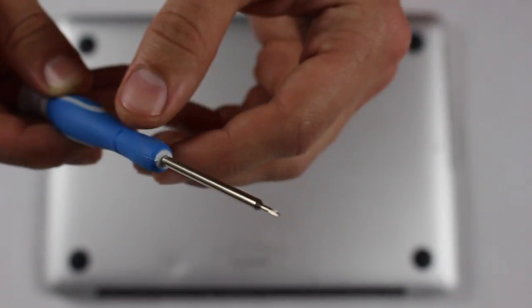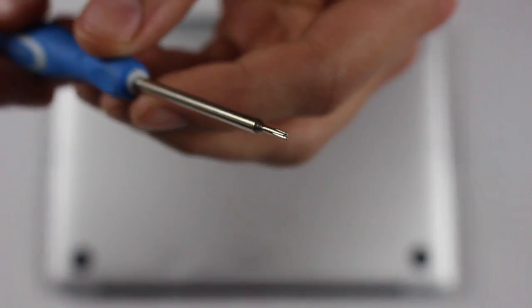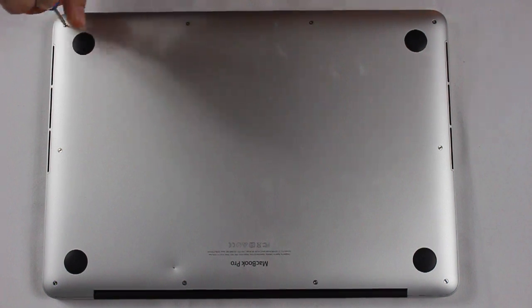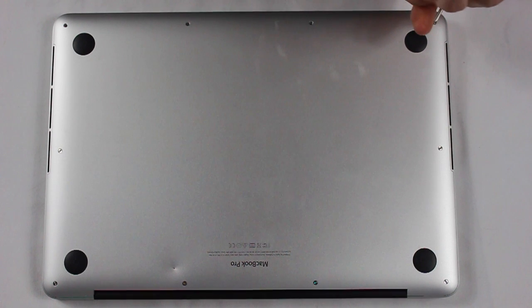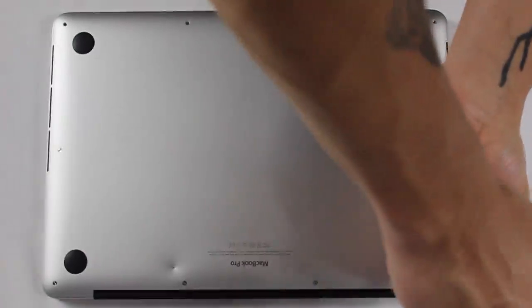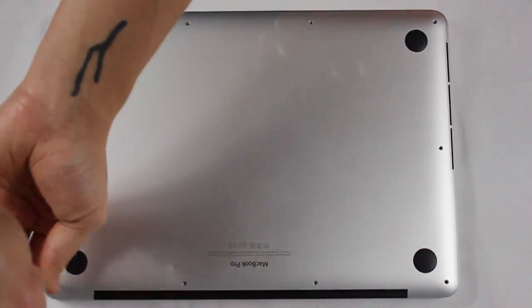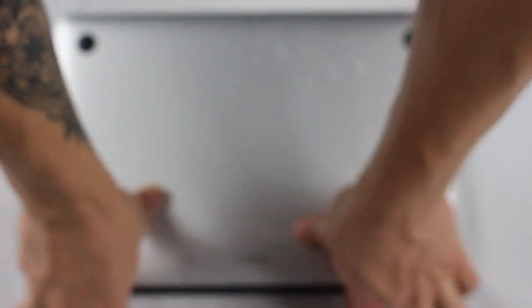It's very small and very thin as you guys will see here in a little bit. One of the tools we're going to need is a 5-point pentalobe screwdriver — these are very inexpensive, I got this for around $3 or $4 on Amazon and I'll leave the link in the description. All we need to do is remove the 10 pentalobe screws on the back to get into the laptop. You want to make sure these are separated correctly because the 2 screws by the black strip can be longer or shorter, and you don't want to damage the laptop.